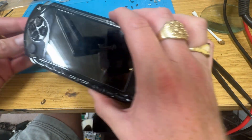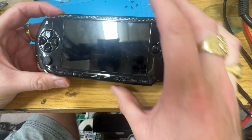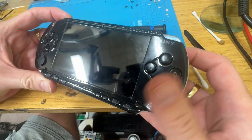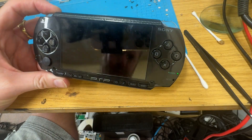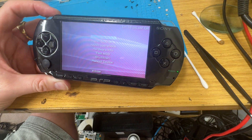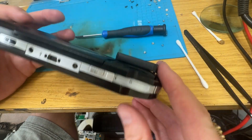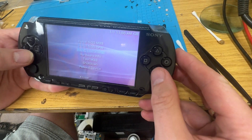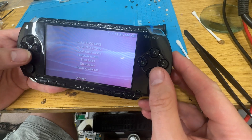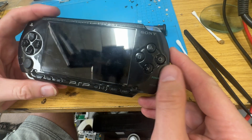Let's put the correct memory card in. Take it back out, put it in - that should bring up a screen where I can flash firmware. There you go. As you can see, we're totally not plugged in but we are running off a battery. This will be used to install custom firmware or revive bricked consoles.